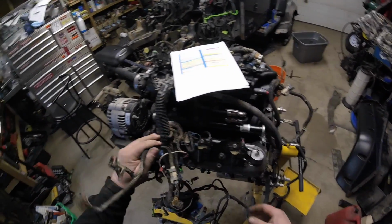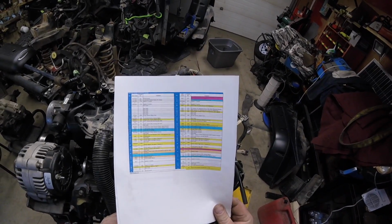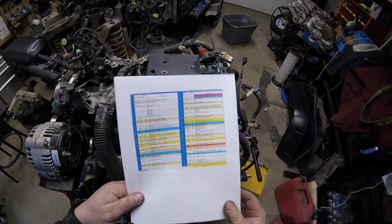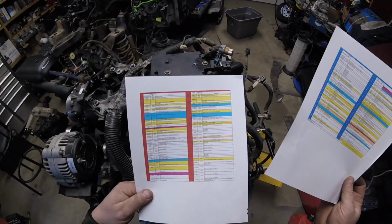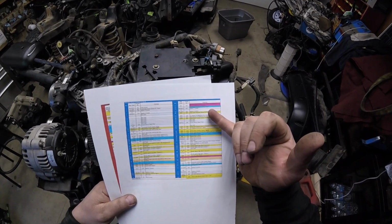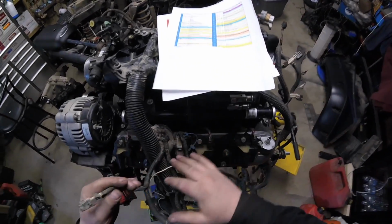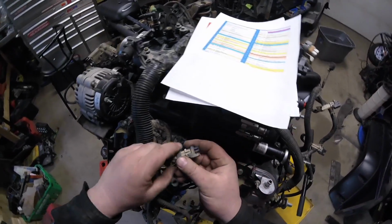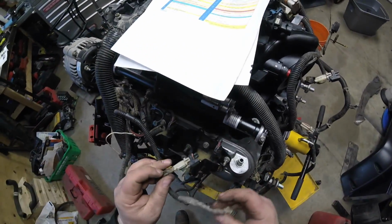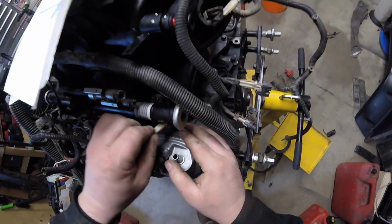Okay, perfect. And then injector 3, we got a pink and black. What's your control wire here? Injector number 3. Where are you hiding? Am I blind? Yeah, pink and black. So this is injector control number 3. Set that one into place. And then these ones here should just assume the position where they would go.